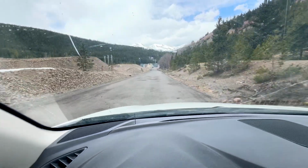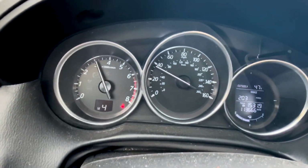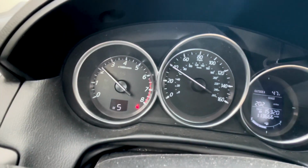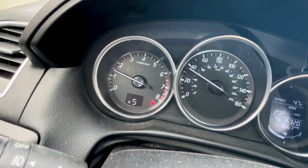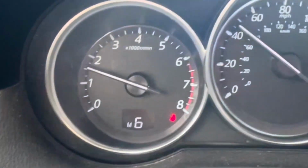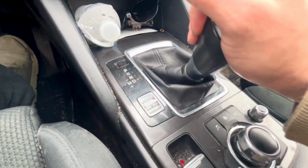I drive down this country road for about a minute. I get up to about 50 miles an hour, turn around once I've hit 6th gear, and turn back home. I take the temperature reading when I've gotten back after this drive, and with an outside temperature around 50 or 60 degrees, it usually ends up at that 120 degree mark, which is where it needs to be to check it.